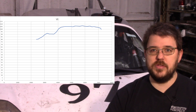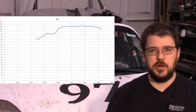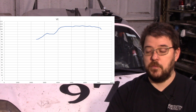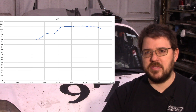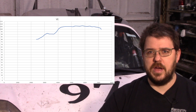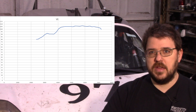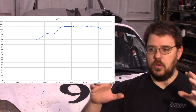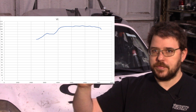Check this out — this is the chart showing the air fill getting to the cylinder. The units are percentage, because telling you 0.875 grams made it into the cylinder is not nearly as useful as telling you the cylinder is 107% full. That's the peak number, and that makes sense because of the momentum of the air. Essentially, this thing is hitting over 100% volumetric efficiency for quite a bit of its range. No matter what we do here, we're not going to get more air into the motor.